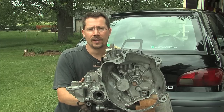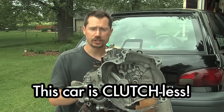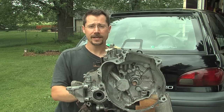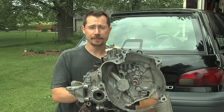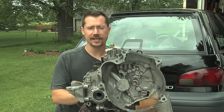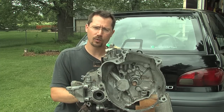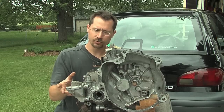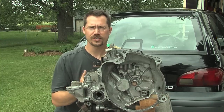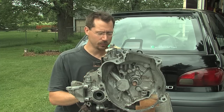Now what we don't need is a clutch — this vehicle is completely clutchless. You can make an electric vehicle with a clutch in it, and that does make it easier to shift, and there are some other advantages to it. You do have to do a little bit more careful measuring, and you'll have to figure out how to attach the existing flywheel onto your electric motor. This is my first electric vehicle conversion, so I didn't do any of that — I just went with something real simple.